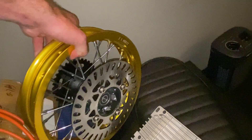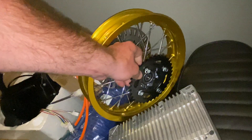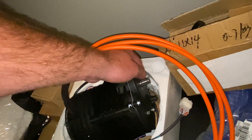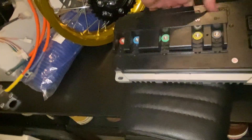I think it's going to be more stable and look a little more balanced — more super moto. I'm running a 210-millimeter rotor in the front and the rear. The reason I can get away with running such a small sprocket in the rear is because the QS138 V3 has a gear reduction of 1 to 2.3 — basically the motor spins 2.3 times and the shaft only spins once. With that reduction you can run a smaller sprocket, which just looks better. I'm running a Votol EM200 controller, the one that comes with the QS138.